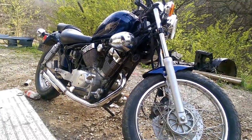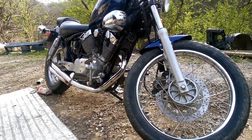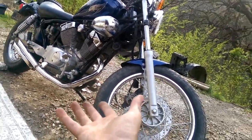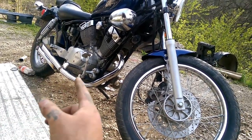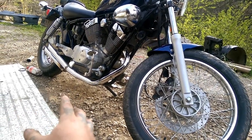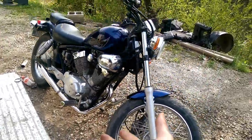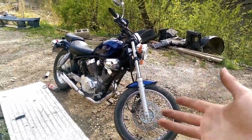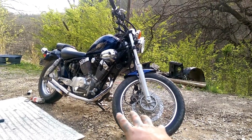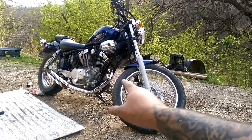That 250 Yamaha sounds a whole lot meaner. The pipes actually look great — once I get the brace on them and the header wrap, I think they'll be awesome. If you're looking to do your 250 like this and want to use your stock pipes, you can pick those up — I think these Harley Davidson-style pipes we used today were around 70 bucks on eBay. My buddy gave them to me used, which saved me a whole lot of money. It just took me an afternoon to build the exhaust. If you've never done this before, get help from buddies who have, or find somebody that has. If you've got a pipe bender you can just buy the pipe and bend it yourself.